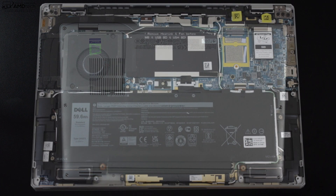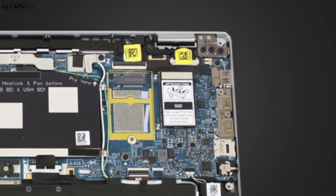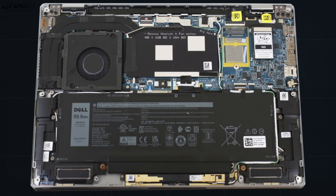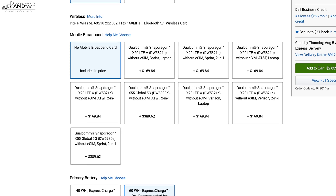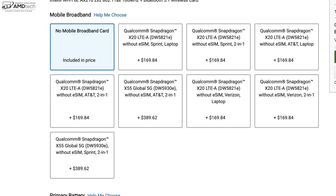To get inside the laptop, just remove the Phillips head screws and pop off the bottom plate. Inside you'll find the 59.6 watt-hour battery — rounded up to 60 watt-hours by Dell. The SSD is user-upgradable but uses the smaller M.2 2230 slot, so you cannot use the larger M.2 2280 drives we normally see. There's also a slot for the optional wireless WAN — Dell confirmed you cannot put a second SSD in that slot, which is a bit unfortunate. The wireless WAN is an option you'll pay extra for, but highly recommended for business travelers needing always-on connectivity.